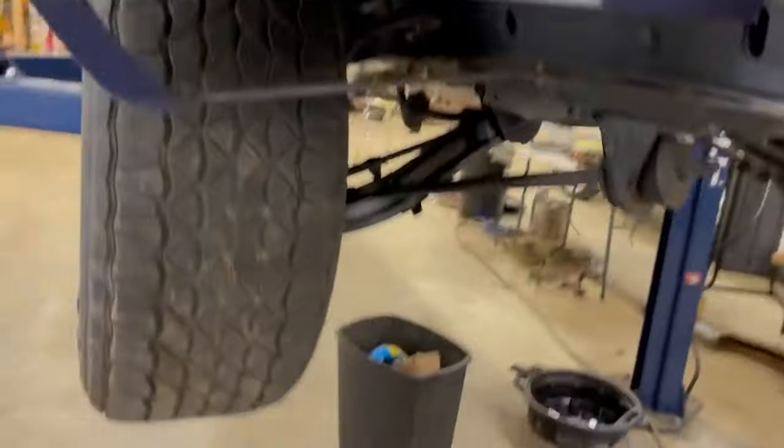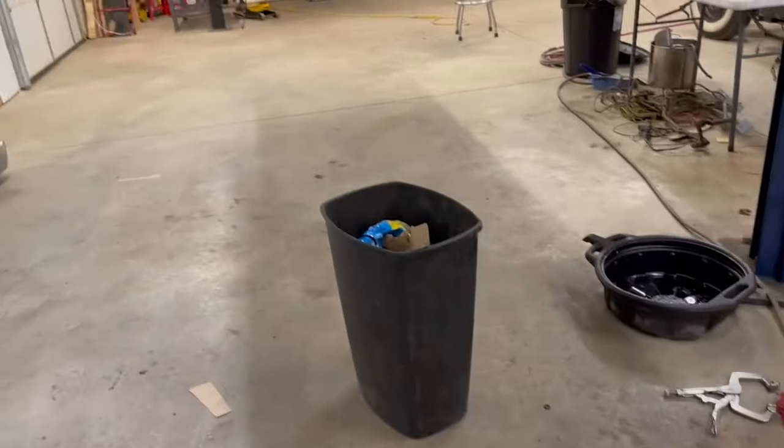With the drum brakes, even with that spacer, it hit the upper control arm, but now, I don't know if you can see or not, but now I've got clearance to that upper control arm, so I should be good. We'll see once I set the car down, but there's a decent amount of clearance in there, and it does fit. I can turn full lock, nothing hits there, nothing rubs, spin the tire nice. We'll turn it back the other way.